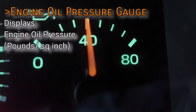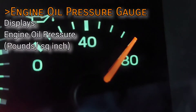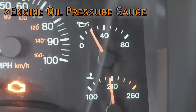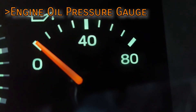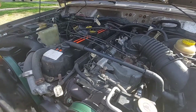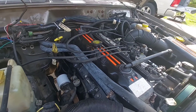The upper right gauge reads engine oil pressure, measured in PSI. The lowest acceptable oil pressure for the 4.0 is 13 PSI — if it runs any lower, you risk causing internal damage. At cold idle, oil pressure should be at or slightly above 40, and idling at operating temperature should be around 20 PSI. Normal cruising should maintain between 35 to 45. I see way too many XJ owners carelessly driving around with a gauge reading 10 or less, but the 4.0 is known to run without oil, so I guess it isn't the end of the world. Low oil pressure can be caused by bad gaskets and seals, a bad oil pump, clogged oil passages, and low oil level.